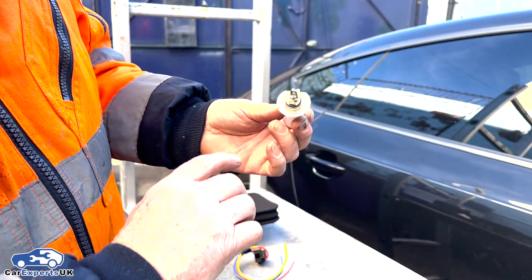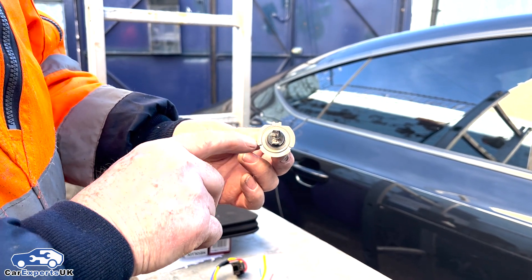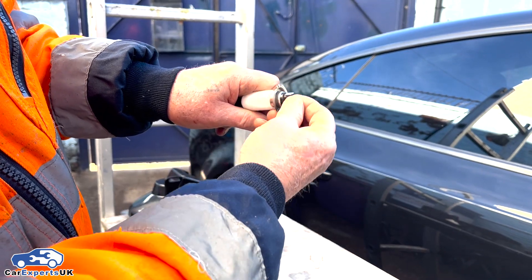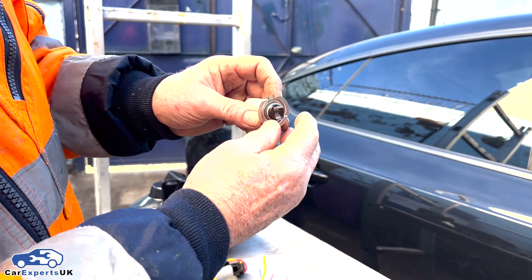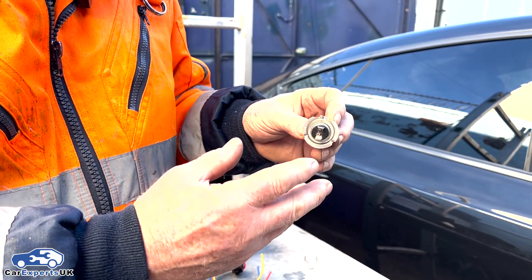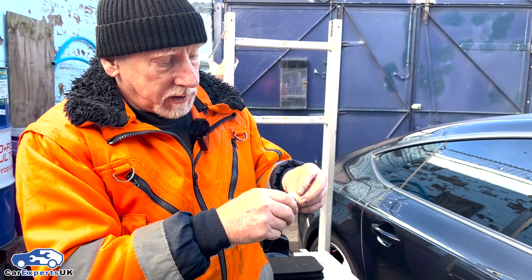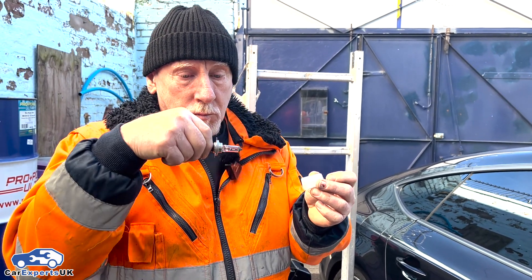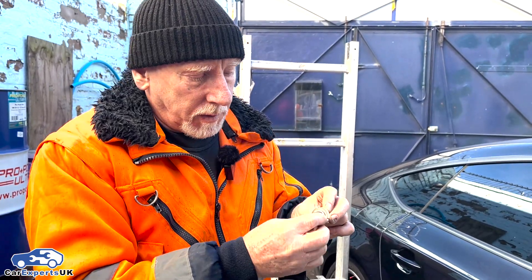On the bulbs you'll find a tab. It's very important that this tab is located properly or the bulb will sit on an angle and it won't sit in the hole properly — it must be flat in the hole. If you've seen cars driving down the road with a headlight very bright, generally it's because the bulb's in wrong and the headlight is pitched on an angle, sticking up in the air because it's not located properly. So it must be in straight, because of this little tab not being in the proper place.